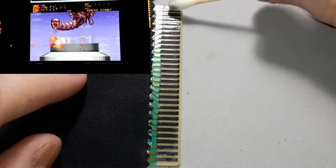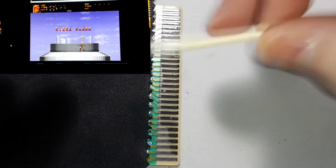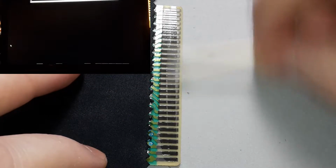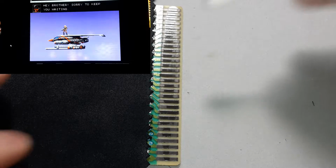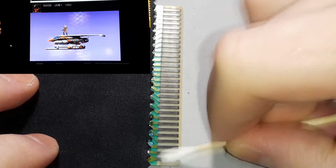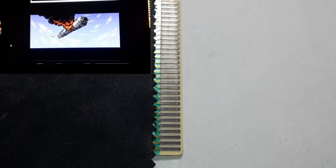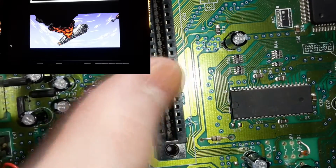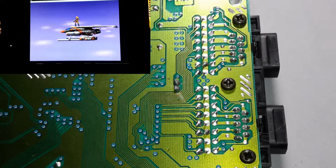If you tear apart your Nintendo, the Nintendo will have this type of header on it too, with the contact pads, outside of the actual cartridge sleeve slot, the socket. You can pull that socket off and then clean this whole area off as well and do the same steps. And the reliability, you will not believe the difference. It's a dramatic difference from cleaning these off. I mean, sure, you can get a new socket, one of these right here, but it won't make any difference if the contact pads are not nice and clean.